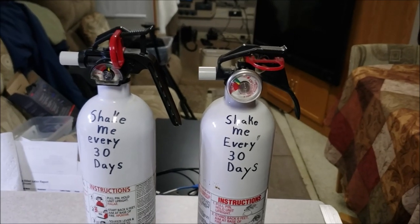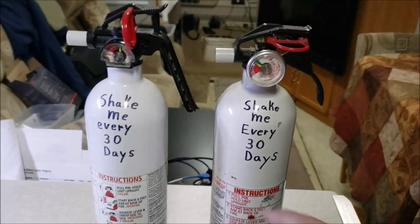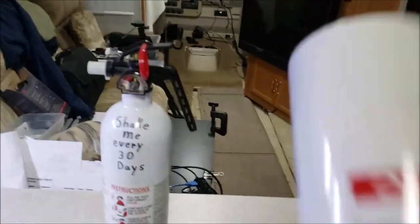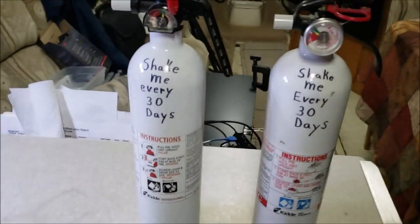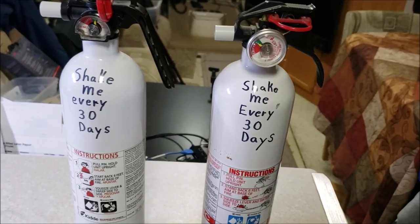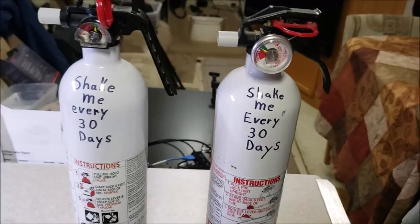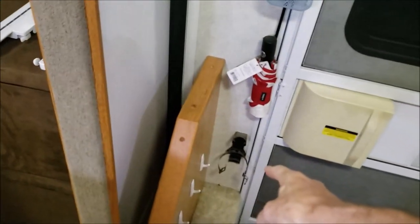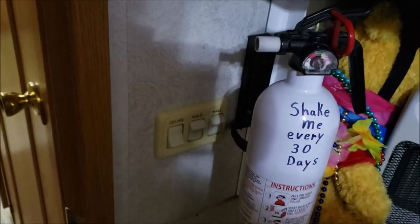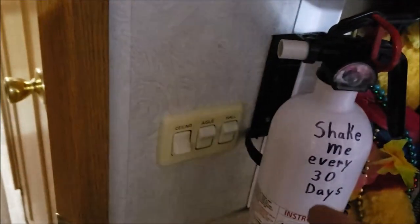While we're talking about smoke detectors, I thought I'd talk about fire extinguishers. We've got two in the RV. Did you know you're supposed to shake these every 30 days — turn them upside down and give them a good shake to keep that powder loose? I already mentioned that 35% to 45% of RV fires are electrical in nature. I keep one extinguisher here at the door and one back in the bedroom by the door, clamped right there — in case anything happens in the middle of the night we've got a chance to put out the fire or get out.